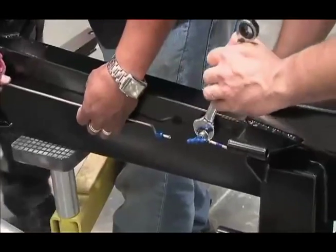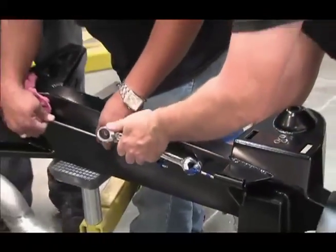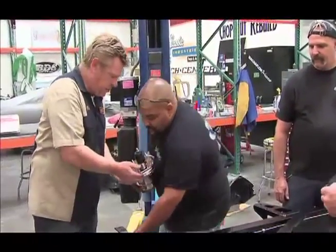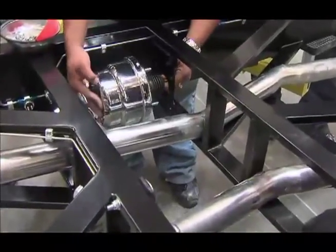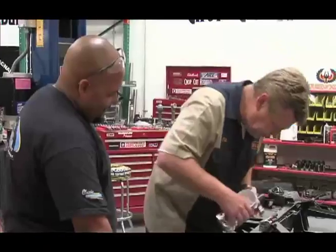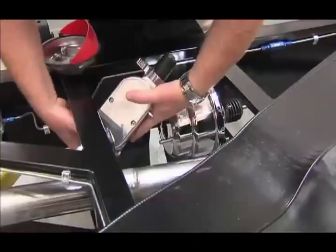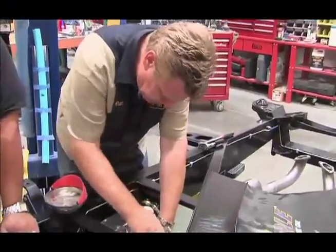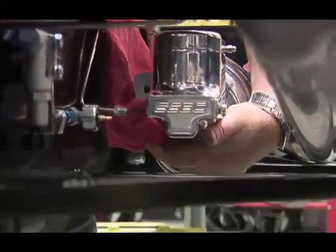Once the exhaust was fully installed, we went ahead and pulled out all the brake lines that we previously pulled off. Using the little clamps from Zoops, we fastened them all around and got everything in position. Then we came out with master cylinder and booster, bolted that up, and we ran into a small problem. We were missing a small adapter to go from the 3/16 hard line into the 1/4 inch. So we're going to have to work something out there to make the correct conversion. It's no big deal because it's something really small, and once we get that done, we'll be fully plumbed for brakes. Problems at this stage won't stop the job. It doesn't even slow us down.